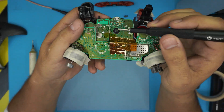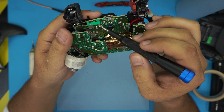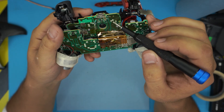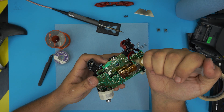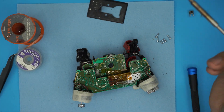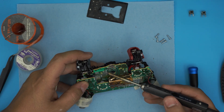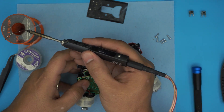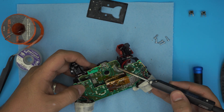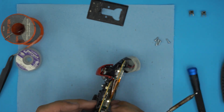Now we don't need to remove anything else. Zooming in a little bit here — these pins right here are the supportive pins, and these pins are the click pins. We're going to desolder these four pins here and the four pins over here. Go ahead and add a little bit of flux right over these pins. This is old solder so we need to mix it with new solder — grab a little bit of solder on the tip of the iron, bring it over, and mix it in with the old pins. Do the second one over here.